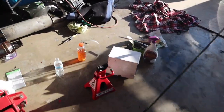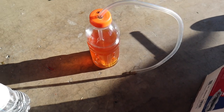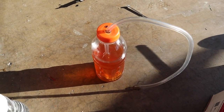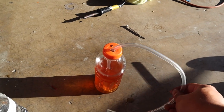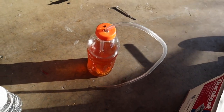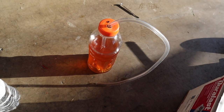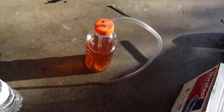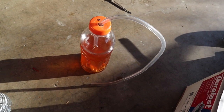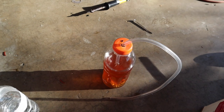Also, if you don't know how to bleed your brakes or clutch, it's really easy. That little tip on the slave cylinder has a rubber piece — go ahead and take off that rubber piece, then grab this hose I got from AutoZone, I believe it's a quarter inch, and slide it on top. You're going to push in the clutch three times — it's easier when you have two people. Have someone hold the clutch all the way down after the third press, then loosen that little nut, and as soon as you see liquid come out, tighten it. That way you don't have any air bubbles going back in when they release the clutch. Do that about three or four times. I got as much of the old fluid out as I could and put new Honda fluid in — I had about two bottles of brake fluid from Honda.